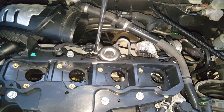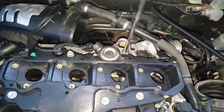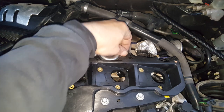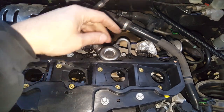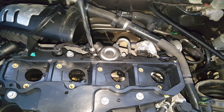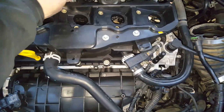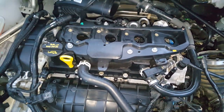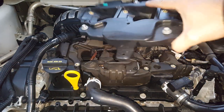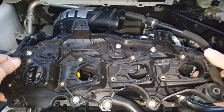We're going to get these other 8 millimeters here and here. This is just our coil pack cover or mount. The 8 millimeters are loose. We're going to go back here and get these 7 millimeters - now these will come out, so you want to get a hand on these so you don't drop them. Little bolts, once they disappear you will never find them again. I've got one more 10 millimeter. So the only other 10 millimeter was right here, and that will have this loose. We should be able to lift this up. This is just the coil pack mount or cover.